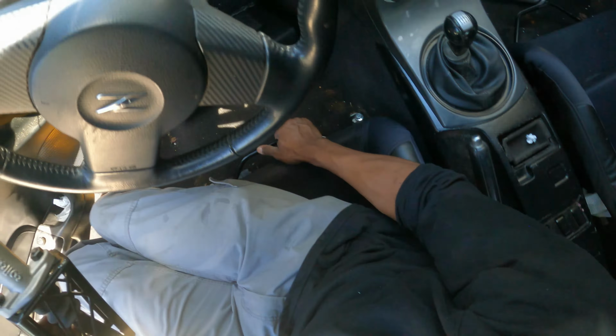So we got this thing to clear, not too bad. See, this thing sits up nicely. So now we have to drill a hole for this e-brake handle to go up. All right, with some trimming, we now have this thing to fit very, very nicely. Cool, so let's go ahead and install a bunch of things back just to make sure everything is good. And then we're gonna have to chop and bleed this thing.